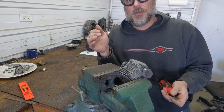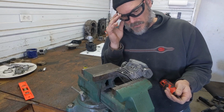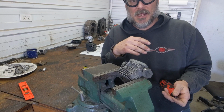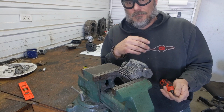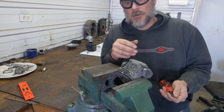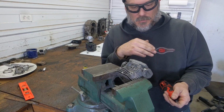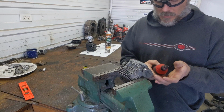Yeah, you'll gain a little bit on the top end, but it becomes difficult to get the saw to idle properly. It just slobbers gas and oil. It doesn't matter how much you lean it out. To the point where if you lean it out enough so it idles properly, then your throttle response suffers because you don't have enough fuel on the low side. So I'm just gonna do a little bit of grinding here and then show you the end result.